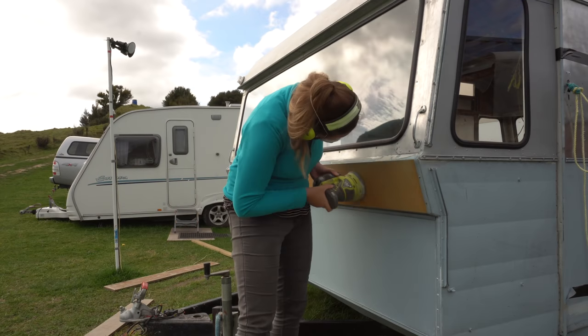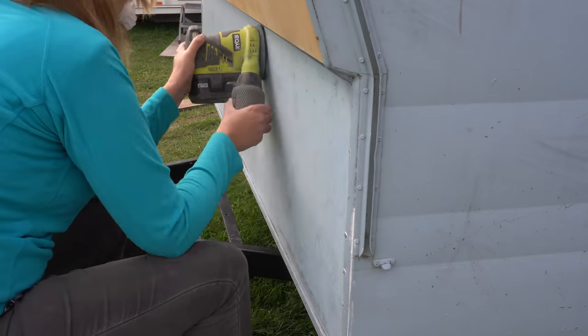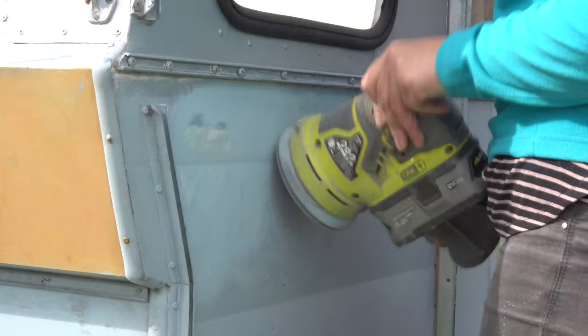I feel like I should start sanding the exterior of Vinnie, getting it ready to paint. I feel like I've done enough sanding on this project already — I'm kind of over sanding. The downside of that battery-operated sander is it races through the batteries, so I've just turned on the generator to charge a couple of them so I can carry on. It's interesting how close you are to the surface when sanding — you notice all the little mistakes and quirks. I've seen there are a couple of small dents at the front. There was an old caravan sign in the corner, which is kind of cool. And there is a slight hole near the front just in the aluminium, so that was good to spot — I'll be filling that one in.